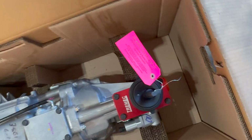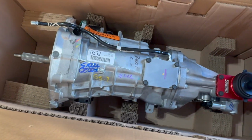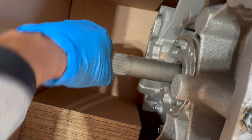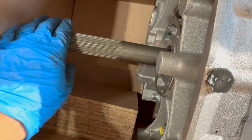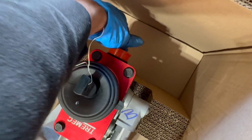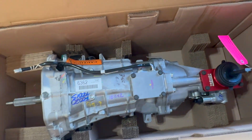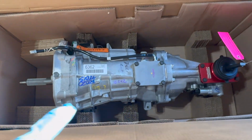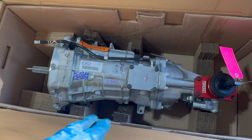Magnum F. Biggest thing, essentially, is the T56 and TR6060 internals. It's got the big boy input shaft on here, so it's huge. Major upgrade, and the output shaft. I've had a Viperized one, I think it's like 31 spline or 30 spline. The Viper and this one switched. I had a Viperized one with the beefier main shaft, but the gears are different on these.